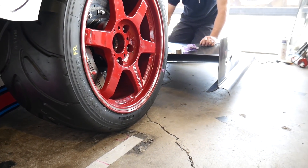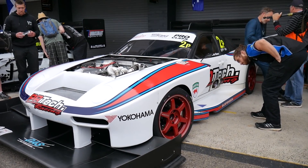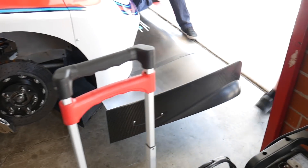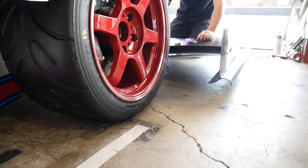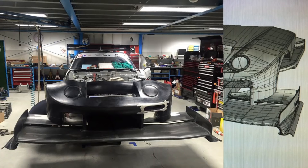With the front wing strategy, there's a quite unique end plate system. Can you talk about the flow control you've been enacting, particularly with the footplate and the expansion at the lower front of it? The footplate is one of our new additions this year. The raised conical section in the footplate is there to house one of the most critical vortices that form on the front splitter — similar to channels seen frequently on open wheel racing cars. There are two vortices interacting: one from the canard rolling over protecting the inboard vortex, and the outboard vortex protected by the channel in the footplate.